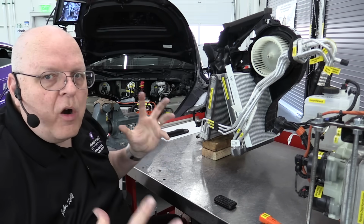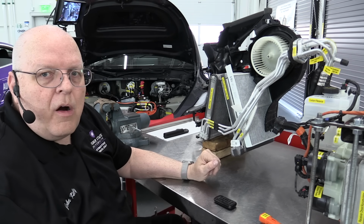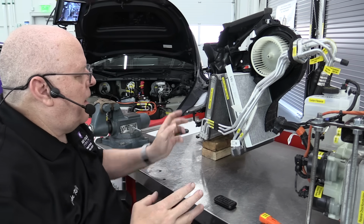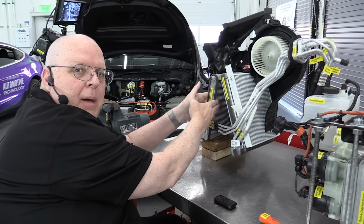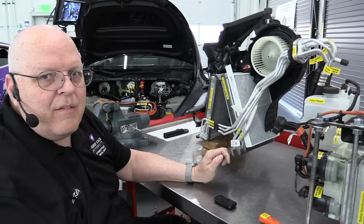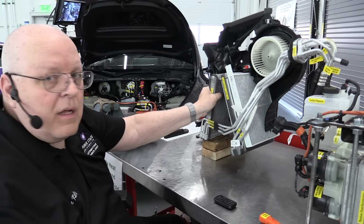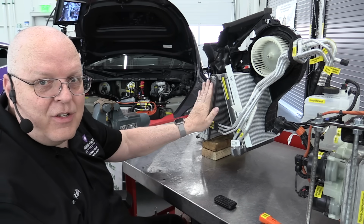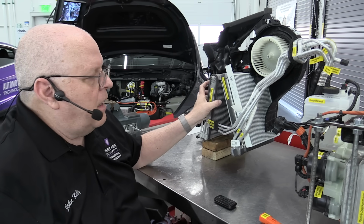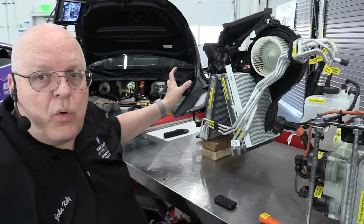So all of the other parts that are involved in the heat pump system operating are there so that we can get heat energy into the refrigerant and pumped inside the cabin here to this inside condenser. Everything that's part of the heat pump system is dedicated to getting heat energy to this inside condenser. So the cabin condenser is the source of heat that air is blown through to heat the cabin.